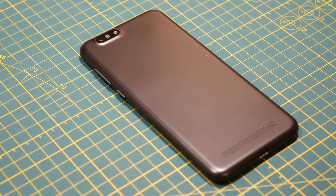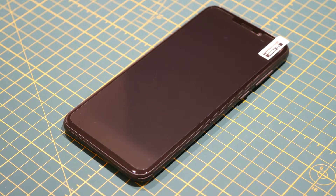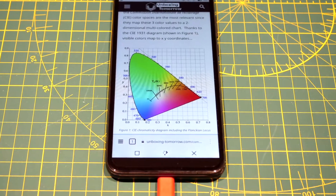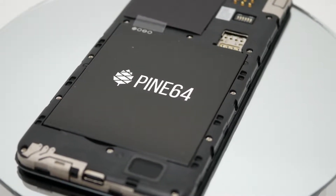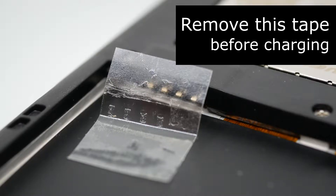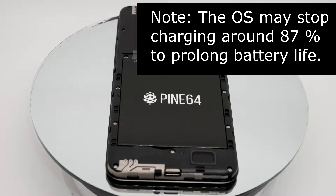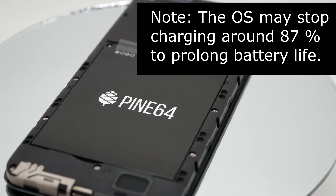The back panel of the phone will have to come off, and because of this, I strongly recommend reading and understanding both the readme file and the manual. The wiki page also has a quick start guide along with specifications for the phone. On the lower right-hand corner, you can check for a notch where you can pry apart the back cover — make sure to not overbend the plastic. When you have the back cover separated, you can see the battery, the dual card holder, the I/O pins, and the phone's kill switches. There's an insulating tape that insulates the battery from the rest of the phone, placed here to keep the battery from discharging while it's in shipping, and the phone apparently will not power on over USB until that tape is removed.